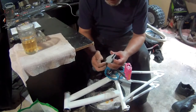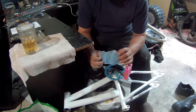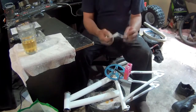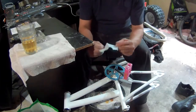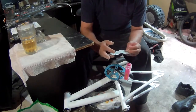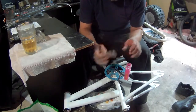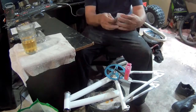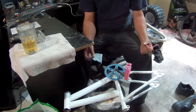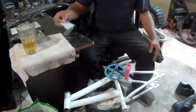Here's my point about using 120 sandpaper and not going to 220 or 300. I started off on this bike with a piece maybe 5 inches by 3 inches. With that one piece of 120 grit sandpaper I was able to do the whole bike. If you were to go to 300 or 220, you'd use I don't know how many sheets of sandpaper. And look how this comes out.